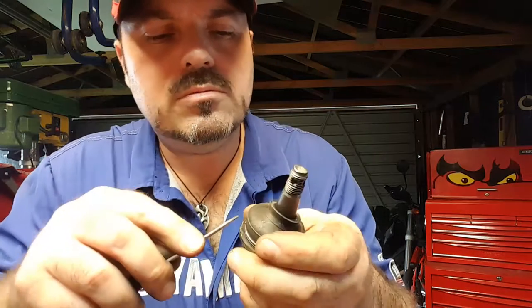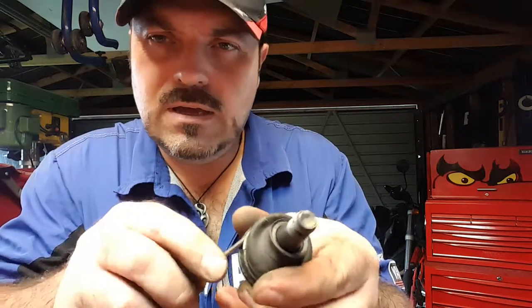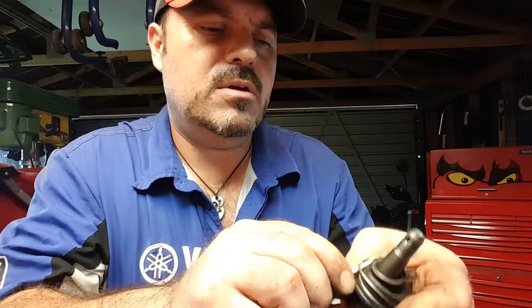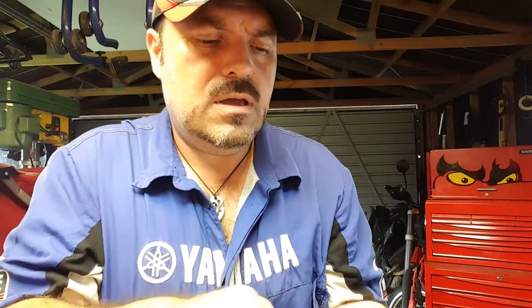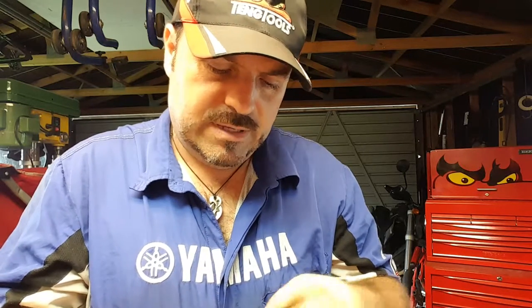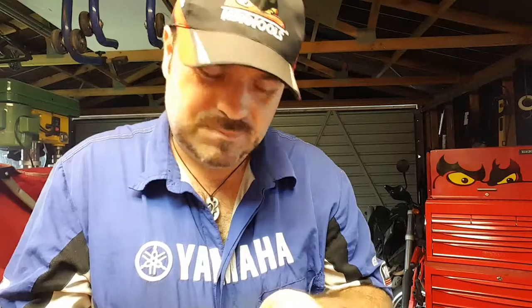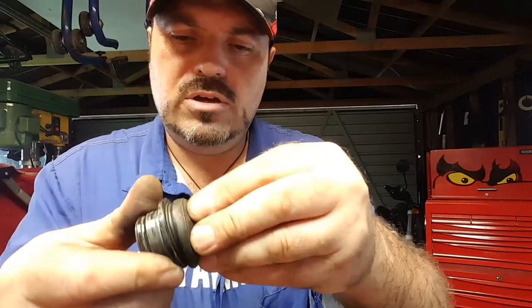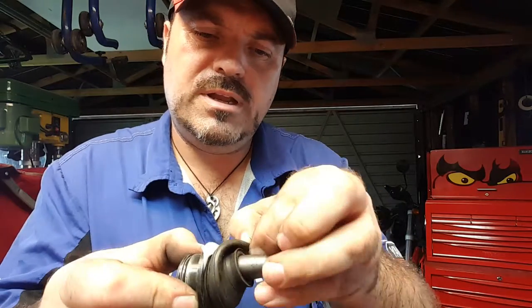So we'll just remove, there we are, look, we'll just put it on camera, Andy, put it on camera. We'll just remove the clip. Now this little clip, it's like a little spring clip, and it just holds that boot in place. Now again, don't forget, we're gonna be replacing this, guaranteed. It's gonna get replaced. So it doesn't really matter if we damage it, it's gonna go in the bin, but out of interest, it's good to see what's going on. So, of course, we've got shed loads of grease coming out now.